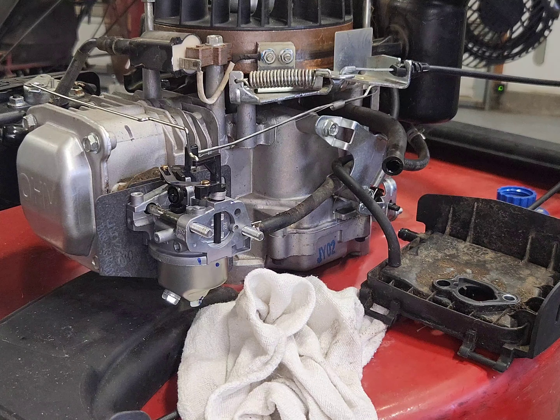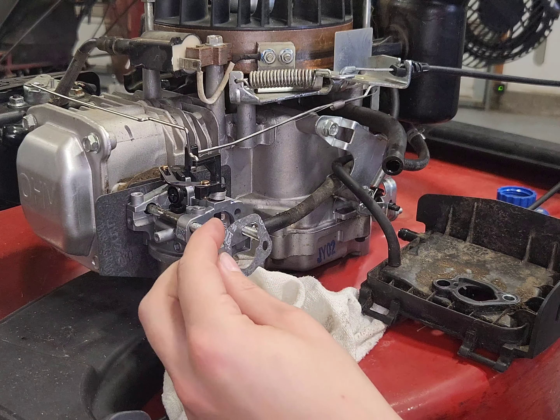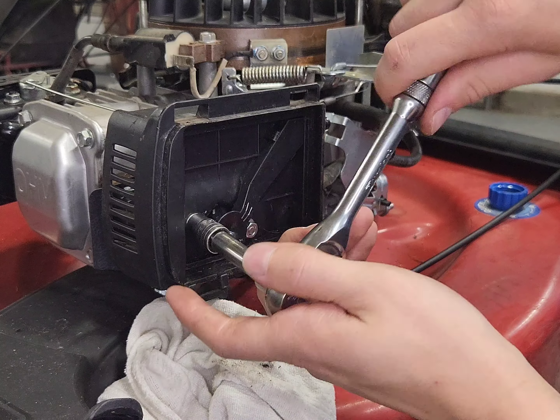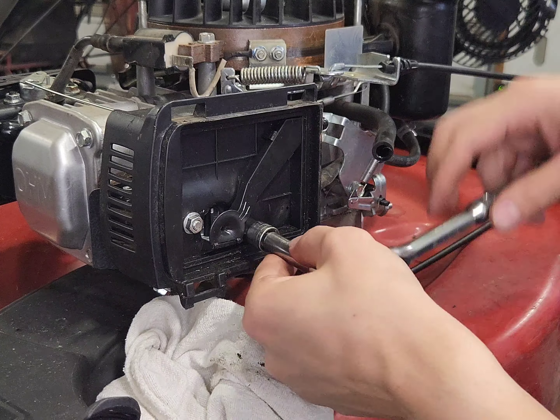All right, that's all functioning properly, so now we'll go ahead and get our fuel line on. Now we'll get this gasket on here, if we can remember what way it goes. We'll get our cover back on — you can see there's metal bushings. There's supposed to be two of them in here and I have misplaced one. If you're in this situation, just be sure that you don't tighten the one you're missing down too much. I'm just going to keep rolling with it. Tighten the one down first that's got the bushing in it. Go ahead and hook our breather back up. Toss our nasty filter back on — I'll be replacing this. And finally our cover.